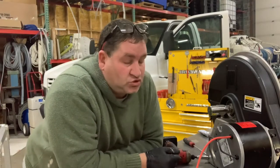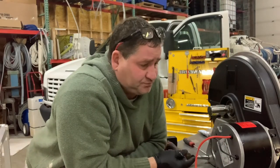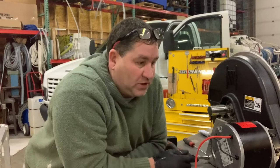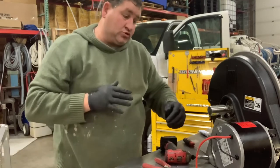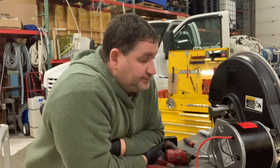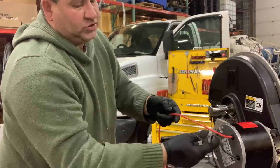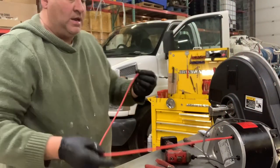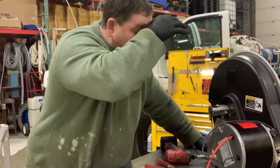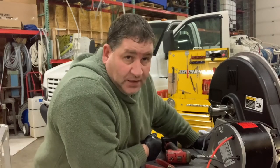No splicing of the wire. This will go right to our relay and up around it. I'm going to show you later how we build these stacker kits. Most of these are 18s; we have other ones that are 22s — a lot of weight pulling it. If you look at every rig, you'll see the stacker kits twist and start to bind. Once they start twisting, they also twist the frame, which causes the barrels to be uneven. So we build the stacker kits like you could pull a truck out of the mud, but there's a clean way to do it. We do ground these to the frame. Now we have this long wire that we can feed up, go around, and go to a relay — done the right way. I'm going to shoot a video on how we install these and how we build out the relays, buttons, and circuit breakers. You'll see that next video.